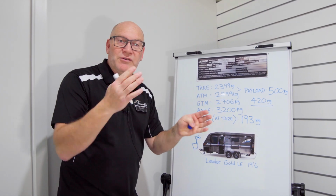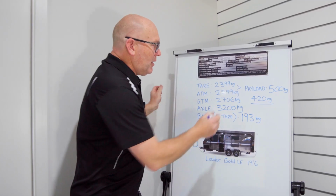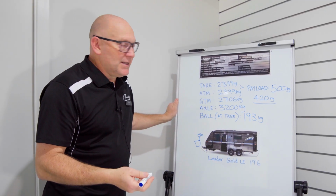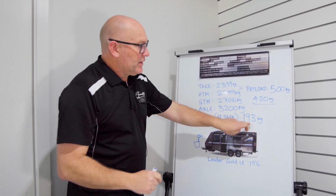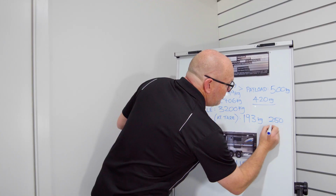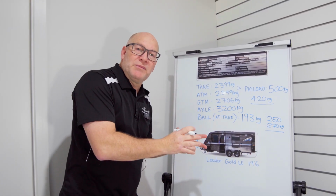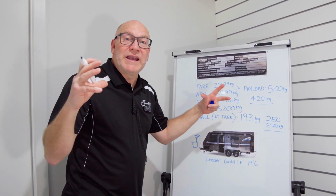Ball weight's not a scary thing. If it's between 200 and 300 kilograms, it's good ball weight. It makes the van tow very well. But you want to be careful that your ball weight doesn't exceed what your car's maximum ball weight is. So the 193, if I loaded this caravan up correctly, would probably end up being around 250, possibly up to about 270 kilograms of ball weight that I have to take into consideration when I'm thinking about the car and what it can cope with as well. So we'll see you in the next video to talk about how we combine those weights.